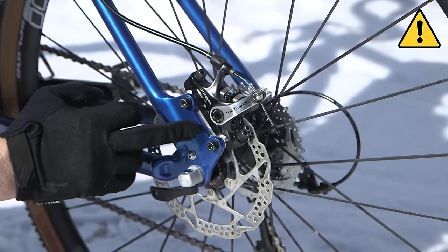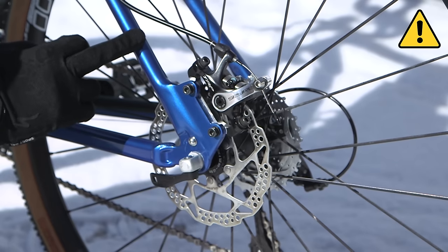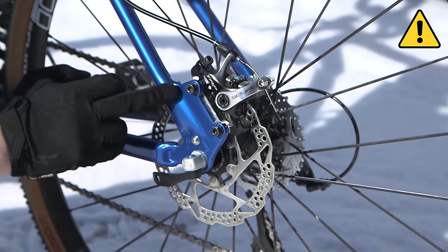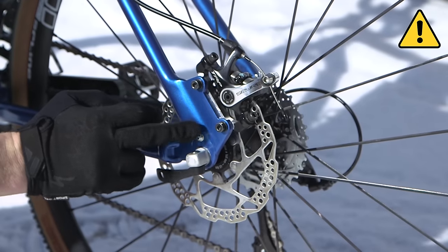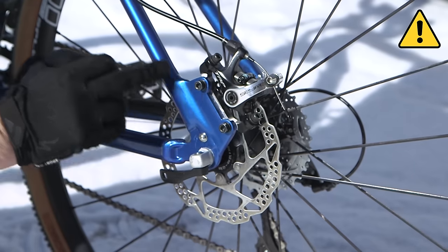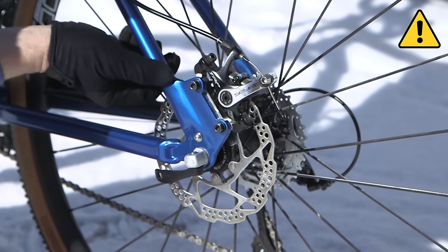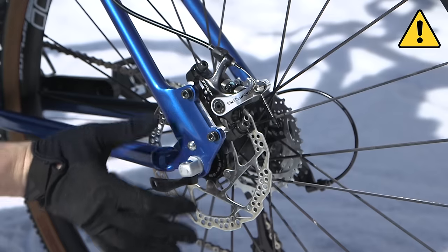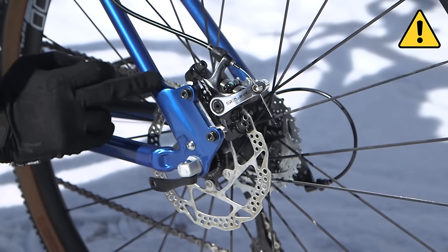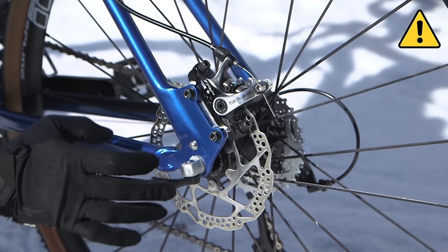The last thing I want to talk about is this disc brake mount and using brazing to attach it to the frame. If you decide to add a disc brake mount to one of these old mountain bike frames, it is highly recommended that you find someone who can TIG weld it — a TIG welded joint is going to be significantly stronger than a brazed joint. If you do use a brazed joint, make sure both surfaces are absolutely clean. The more brazing material and overlap you have, the better. Design the mount so you have a lot of surface area for the brazing to bond to, and after brazing is done, minimize how much material you remove — the more you remove, the weaker the joint and the more likely it is to crack.